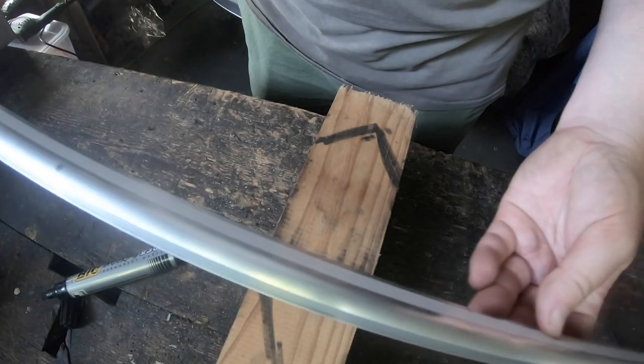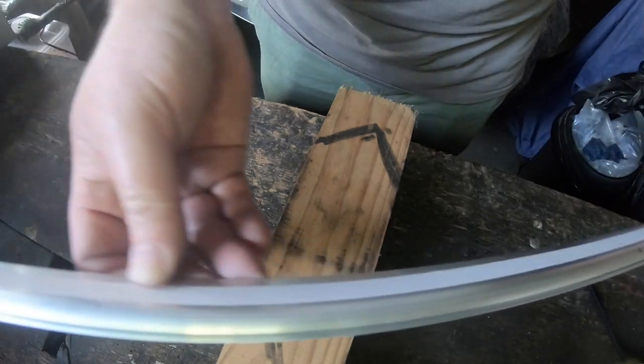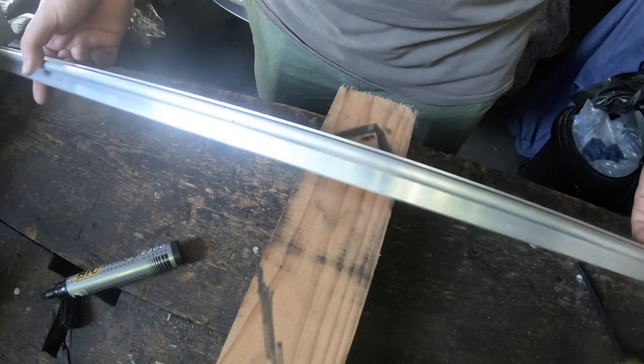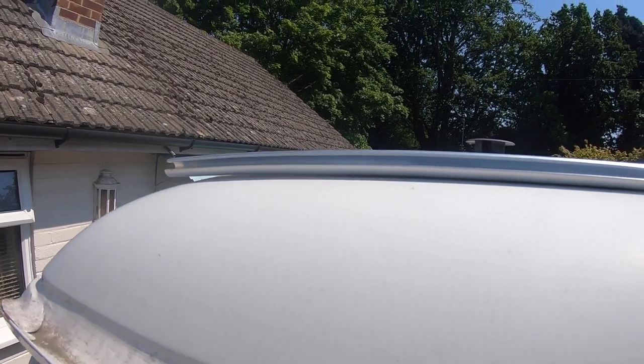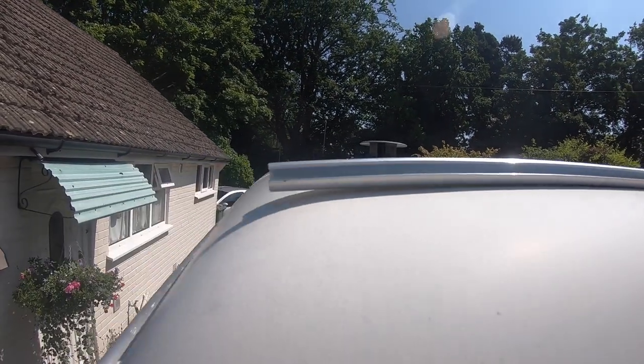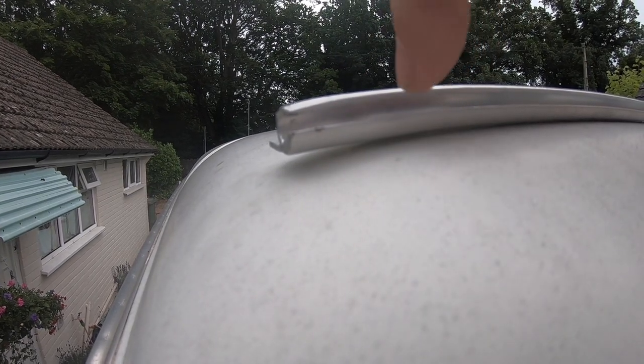I've got a nice even curve through the awning rail now, hopefully it's gonna be about right for the roof. That's looking pretty good — it's virtually level the whole way across, just the ends need a little bit of tightening up. You can see that little gap over there — I basically just need to shorten this awning rail about an inch on each side to get it flush. I need to cut that little end off; just an inch off should do it. The awning rail is fitting beautifully now.